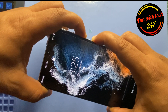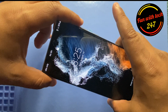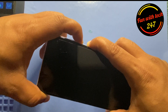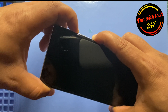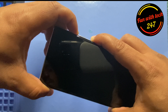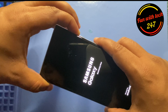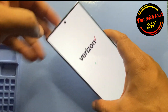Let me just do it one more time. As soon as the screen goes black, you're going to release the buttons and start holding the volume up and power button. I'm holding down the volume down button and the power button. Looks like this is shut down, so now I'm holding the volume up button and released the power button. Looks like the whole process didn't go through, so we have to try one more time.